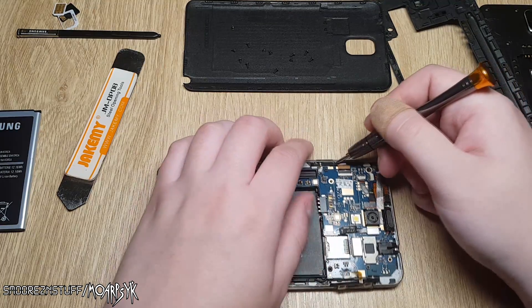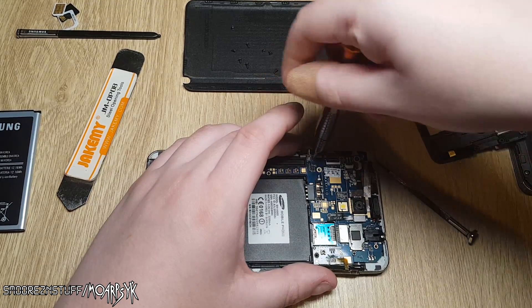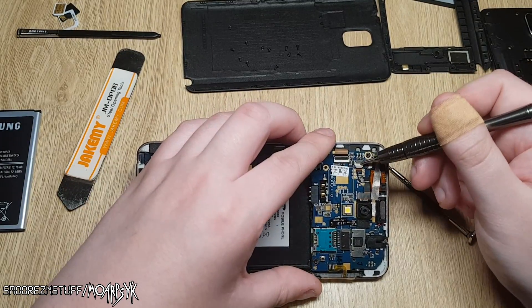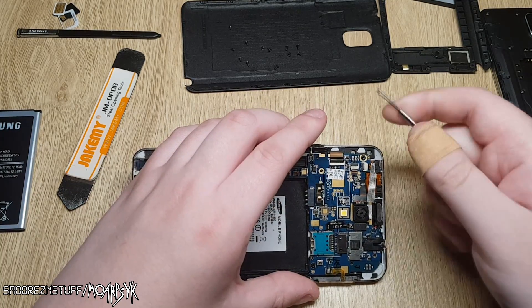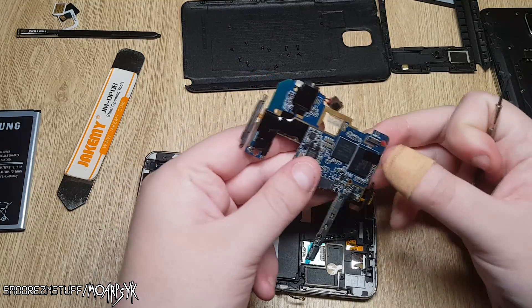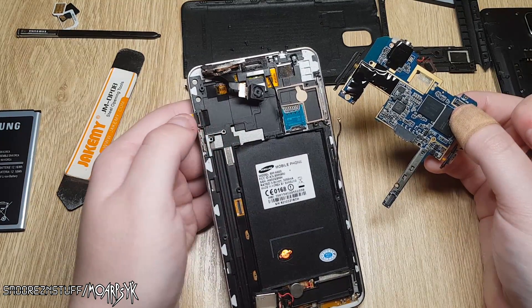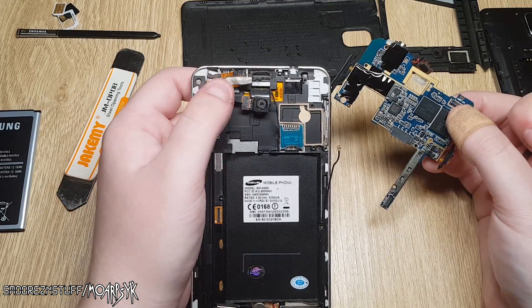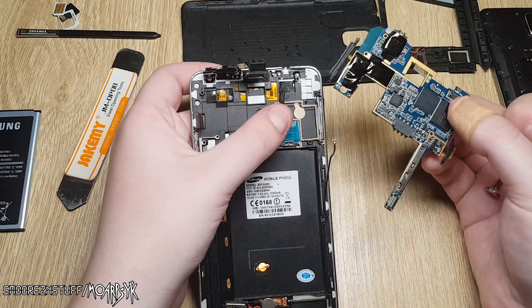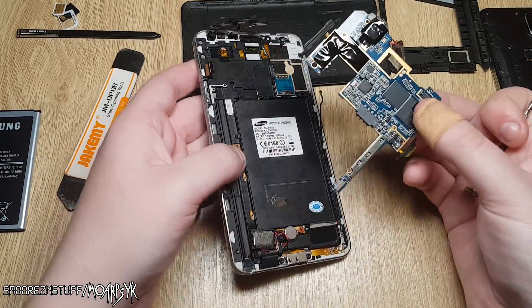The buttons here can just lift out, presumably. Let's get all these little screws out so we can have a look at the main board properly. I like how the loudspeaker is just on an angle. Let's take out all of these ribbons — using this one instead just because it looks safer. It's not safer, but whatever. That seems to be the motherboard taken out. So pretty much what we're left with: digitizer, LCD, the camera ribbon all in one piece. The earpiece is part of the motherboard. And the SIM card slot is all part of that too. There's not really much to look at — all of that just joins into a separate connector.